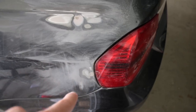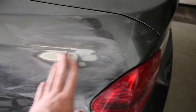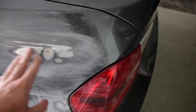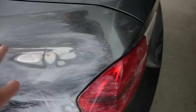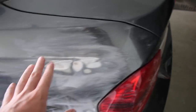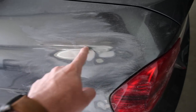Alright guys, we're out here making plays. Honestly, that spot needs a little bit more Bondo. I figured out how to make it perfect — for some reason there's an indentation from the bullet kind of pushing the quarter panel inwards. I'm gonna try to — I can't really hammer it out because I already put the stuff in the back. It's not that big of a dent, but I do want to get that fixed. So I'm gonna put a little bit more Bondo and try to get the surface as perfect as I can. It's probably the hardest part because there's this line going, so I'm gonna try to work down here and avoid that line so I don't mess up anything.